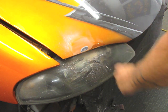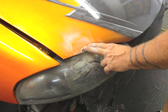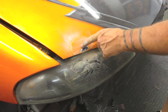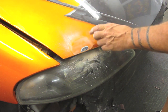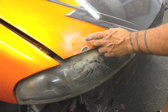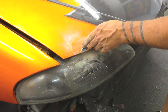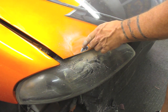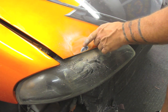I started sanding a rock chip without the camera on. If, for example, you're spotting in the front end on something you never painted and you don't know what the underlayment color is — say you know it's candy tangerine, but what color is it over? Is it over a silver base? When you sand down a layer, you can see I put a gold base under it. I know that's the base I have to work with. If you didn't paint it yourself, you wouldn't know that.